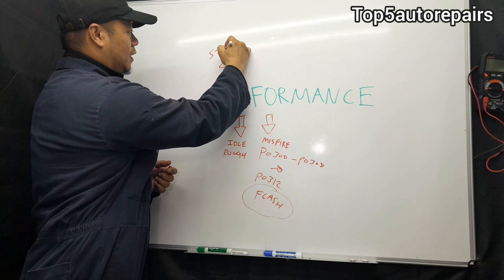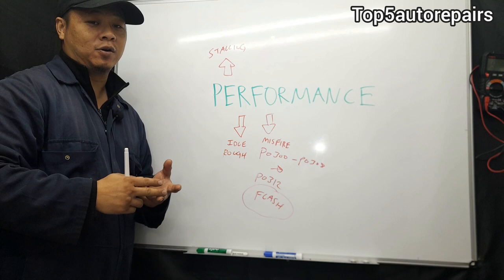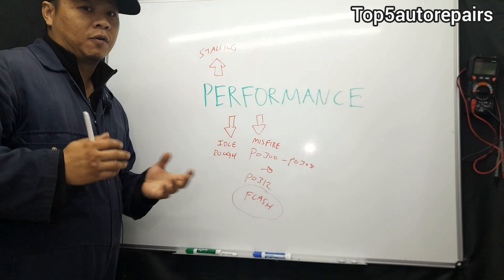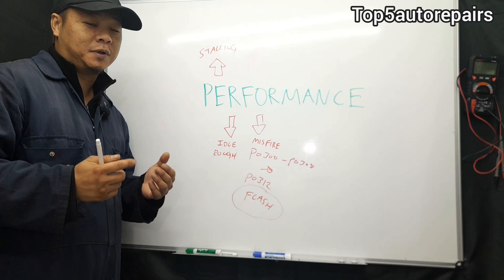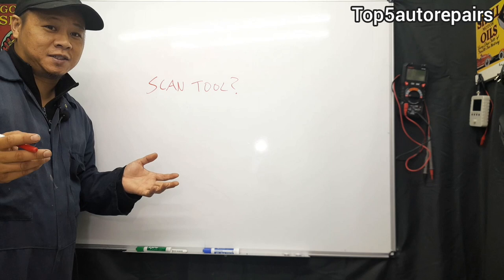When a vacuum leak is extremely severe, it's going to cause stalling. Note that a vacuum leak mainly affects engine performance during idle or extremely low speed, not while driving. Let's say you're driving and you get off the highway, come down the ramp, slow down, step on the brake pedal, and your engine suddenly stalls — that's going to be caused by a vacuum leak. Of course, there are other reasons an engine can stall — low fuel pressure, bad idle air control, a severe misfire from coils, spark plugs, or bad fuel injectors — but if you're coming to a stop, hear a hissing noise, and the vehicle stalls, focus on vacuum leak.